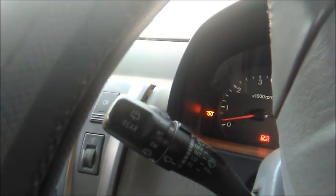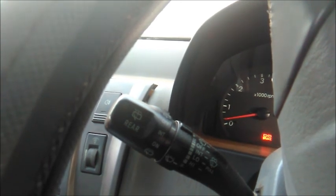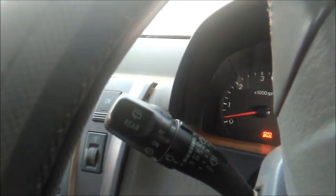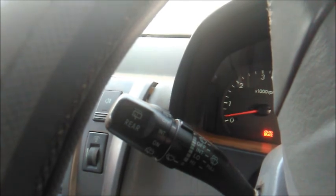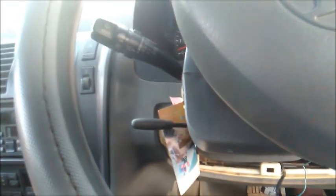But you can clearly see the engine is running, but it's not happy. It's like it is being starved of fuel, but for sure the fuel pressure is enough, at least at idle, because I've compared the target and the actual, and they are matching very well. At first I wondered if it was the turbo, and then I noticed that even at idle, when I step on the accelerator like I'm doing now, the RPMs don't do anything at all.